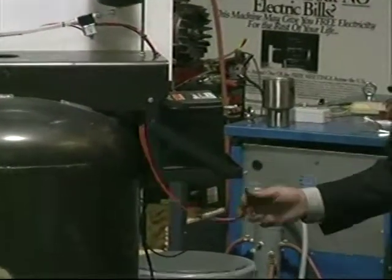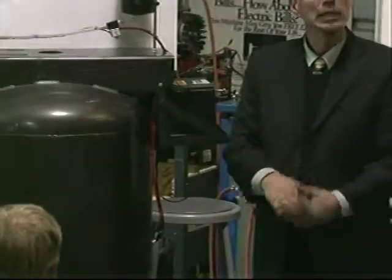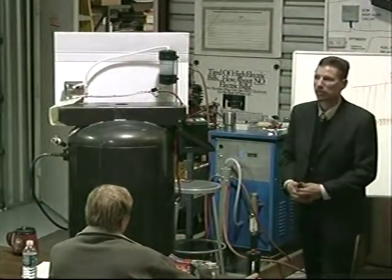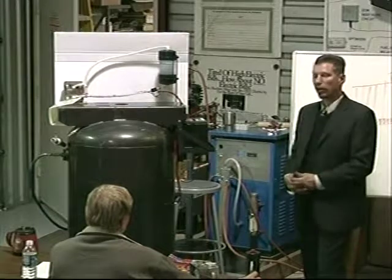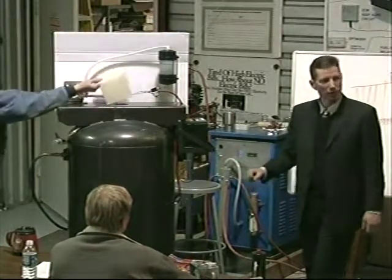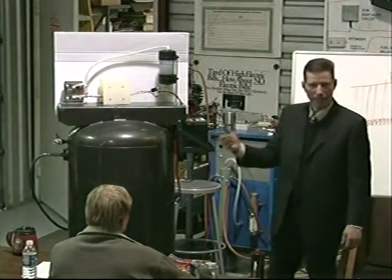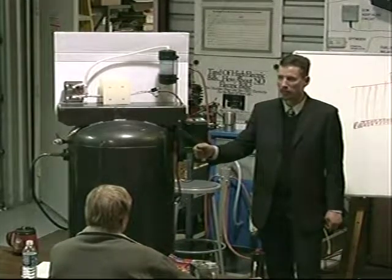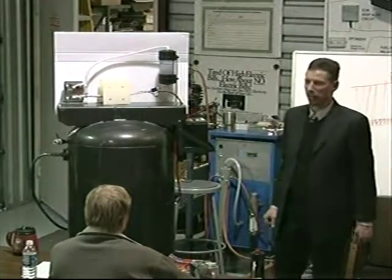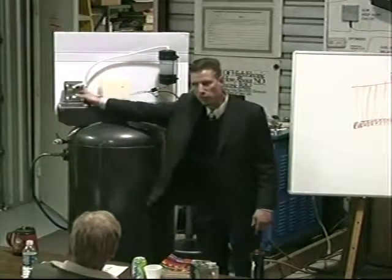The question was asked, what happens if you hook them both up on a four-cylinder? If your charging system can handle it, go for it. It's still worth it. But remember, that car is going to be sitting at a traffic light with an automatic transmission in drive, with the defroster motor going on high, with the AC clutch kicking in, because that's what happens when it's on defrost. Plus, you're going to have the wipers going on high because it's raining. The headlights are going to be on. So the alternator has to carry that load plus the fuel cell.